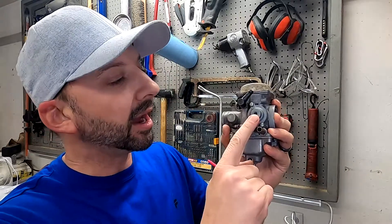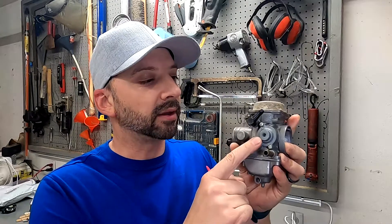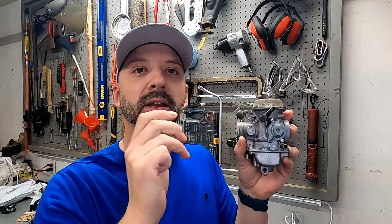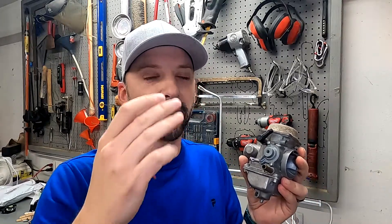If you've got a diaphragm type carburetor, you probably have an air cut-off valve on the side just like this. Underneath there is a spring and a diaphragm that operates when you chop the throttle off from high RPM, using the vacuum created on this side. It opens up and adds a little bit more fuel to the pilot circuit, letting it into the engine. When you chop the throttle off, it doesn't go pop, pop, pop out the exhaust — it enrichens the mixture just slightly enough so as the engine RPM comes down, it doesn't pop and go lean.